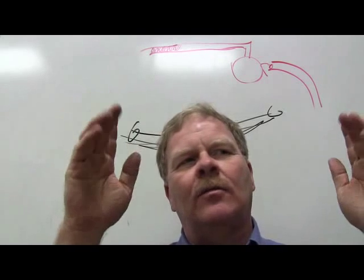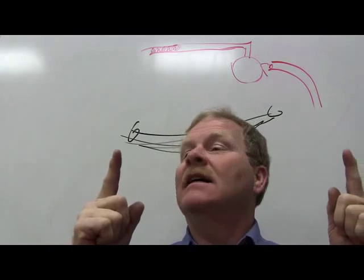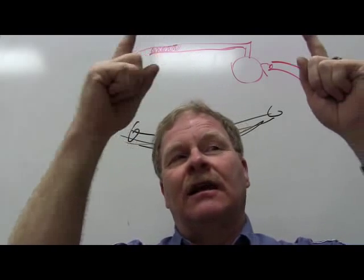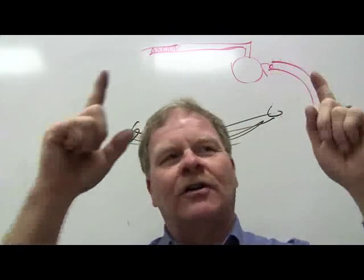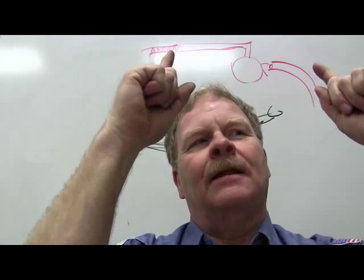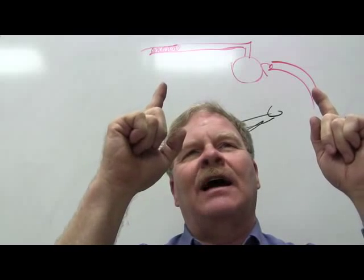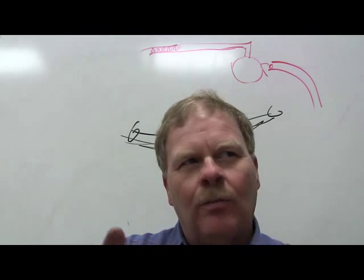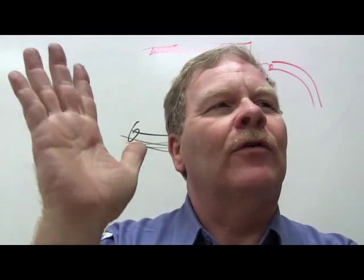Caster has to do with the steering axis. The steering axes are tilted inward — like a table with legs angled in being more stable — and also tilted fore-aft. When set up correctly, turning the wheels actually picks the car up slightly, and when you return to center the car settles to its lowest point, which is why the car wants to go straight when you let go of the wheel. Positive caster is like a shopping cart caster with the stem tilted back — it creates stability. If you push a shopping cart caster with the stem straight up, it wobbles everywhere; tilt the stem back and it tracks straight.